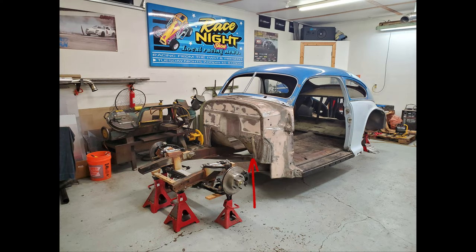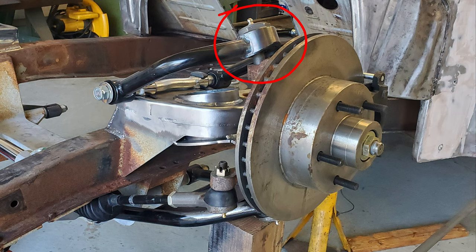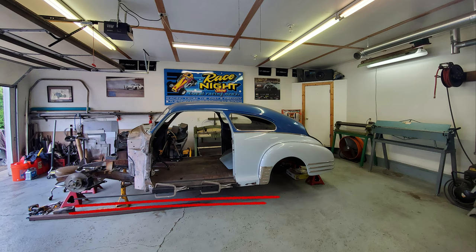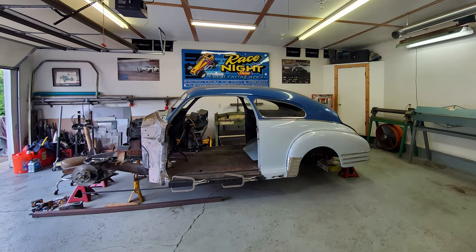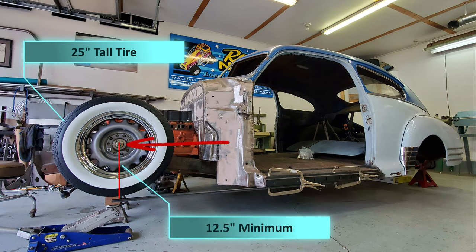I quickly realized the suspension did not have the range of motion I needed to lay on the rocker, so I got to work making modifications. I ended up cutting the ball joint cups out of the upper control arms and repositioning them to gain clearance and increase the range of motion. I also shaved both sides of the cup where it was contacting the steering knuckle at both ends of the travel, and did this to the outboard side of the lower control arm cup as well. I used the angle iron clamped to the rocker panel to ensure I had enough suspension travel to lay the car on the ground. My tires are 24 and 7/8 inches tall — let's call it 25 inches — so I knew that the center of my spindle's king pin would need to be at least 12.5 inches up from the rocker.